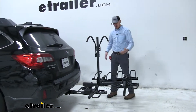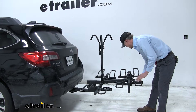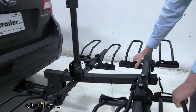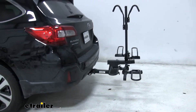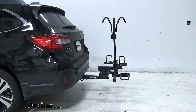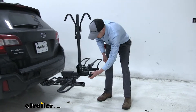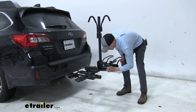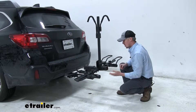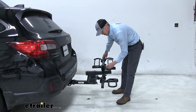As I said earlier, it can be converted down to a 2-bike rack — I'll show you how quick and easy that is. We'll undo our anti-rattle lever here at the very back, then here in the center simply pull out the clip, and it slides out. Very easy. When that extension gets removed, you can actually replace the hitch at the back with a reflector, which is going to help us remain visible at night. If you had the cargo carrier I mentioned, that carrier just slides right into the back of the 2-bike rack. I'll go ahead and fold this down and we'll grab a few more measurements.